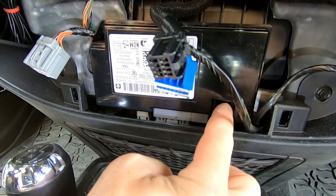That actually went really well. It took about an hour, but we've taken this dash apart probably 3,000 times — if it's your first time it may take about an hour and a half. Take your time, don't break any plastic components. The USB plug is right behind the HVAC controller — watch that bottom right screw because it will fall into the bottom and it's going to be a booger bear to get back out. Magnetic tools will come in handy. Also make sure that's the first screw you put back in — push it in through the harness and module, put your socket on it, and tighten it up.